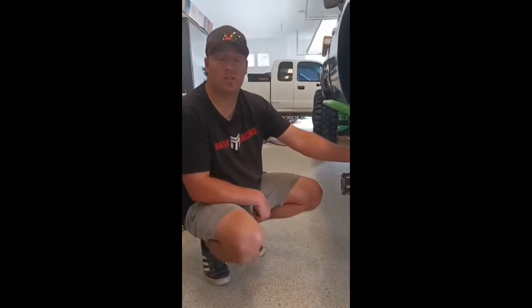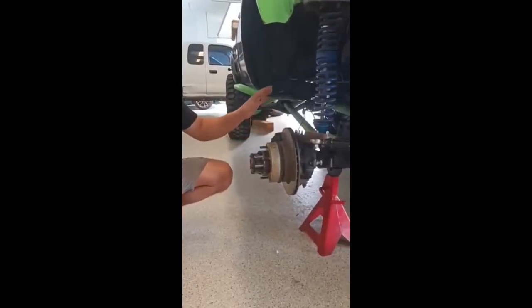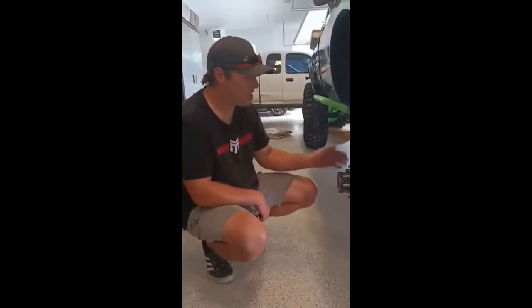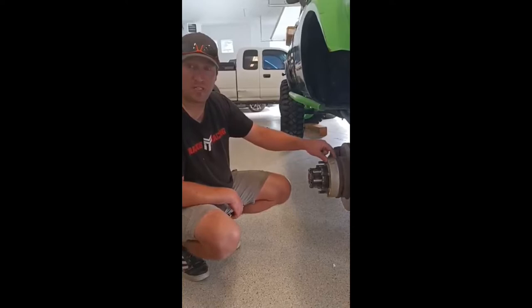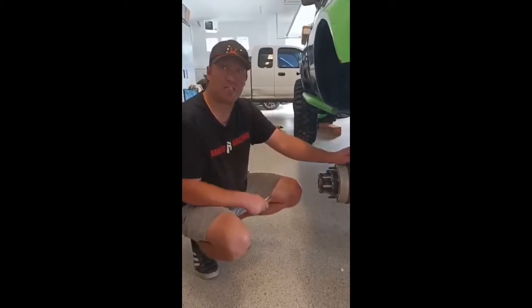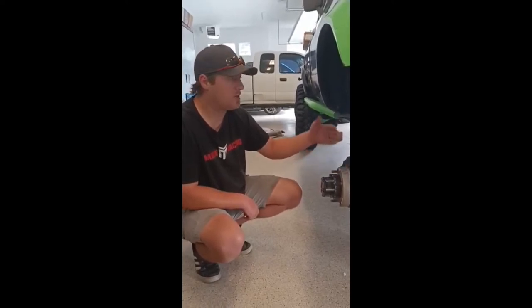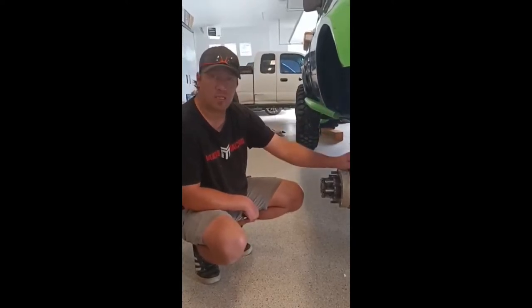Felix has a lot of work that needs to be done. The first thing we're going to do is replace this caliper, replace the wheel seals, and just kind of go through the front axle to make sure everything's good and happy. We've taken off the tires and ruined some wheel studs, so we'll be replacing those. We've got spacers because we have an IFS housing in the rear — a v6 housing, three inches wider than a stock '79 — so we have to put inch-and-a-half spacers in the front to make the wheels sit out correctly to match the rears. Let's get tearing it down.